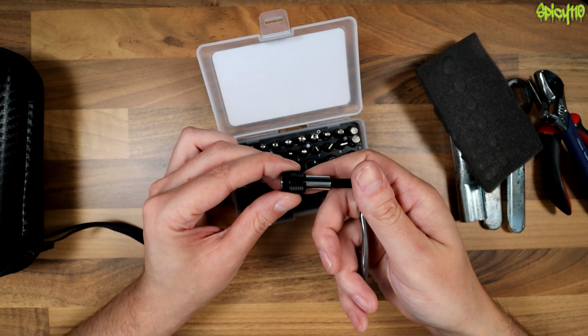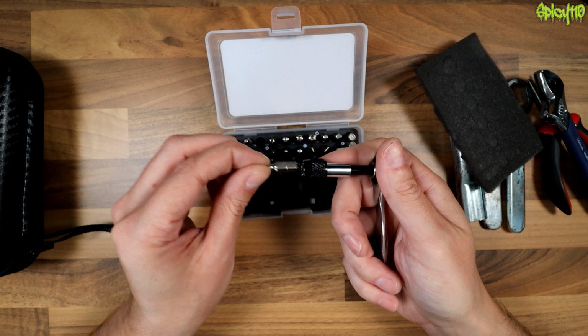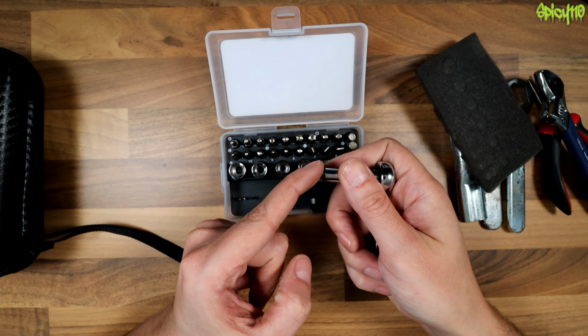However, when I bought this from Amazon, when I put the first one of these in here, it got about that far and then got wedged and would not come back out. I had to wrench it out. And what actually was the problem is inside here, there's a little angled cut on a tube and they hadn't deburred it.